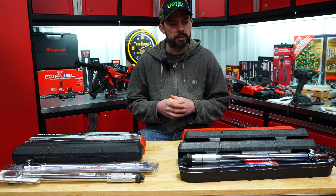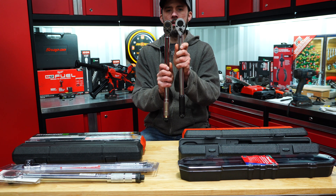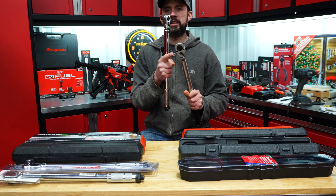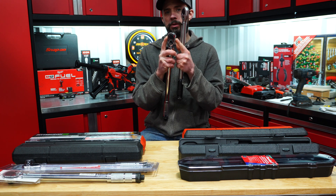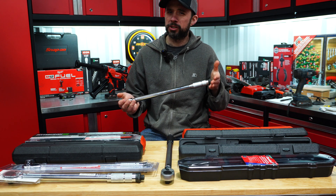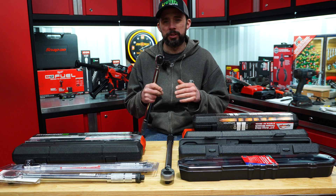From what I've tested here, they're all 24-tooth. The only real difference is in the head profile of the Duralast — it's definitely a lot bigger on the Capri versus the Duralast. This head size is pretty much the same across the board on the rest of the torque wrenches. The Duralast is the oddball, being a little bit narrower, which might help you in tighter situations. Overall lengths are pretty much the same — about half an inch difference give or take. The biggest difference is the EP Auto being the shortest.